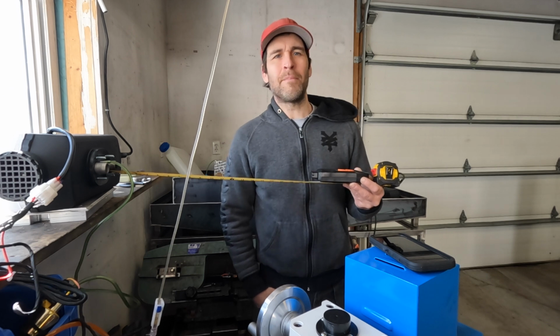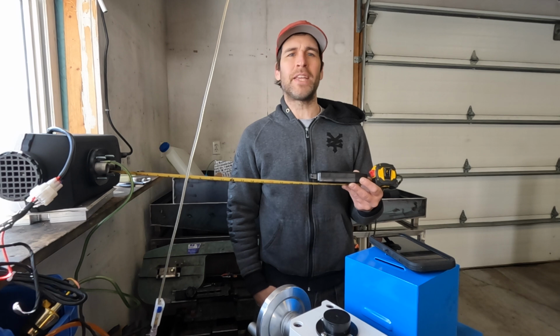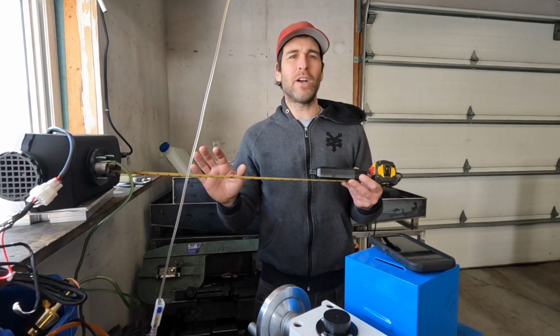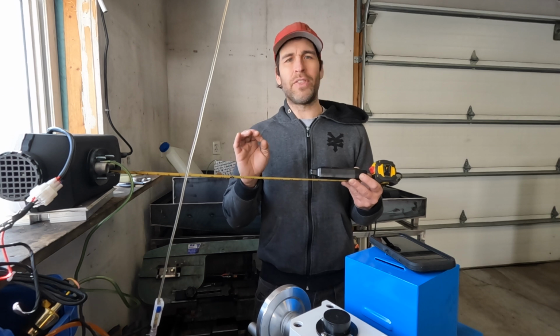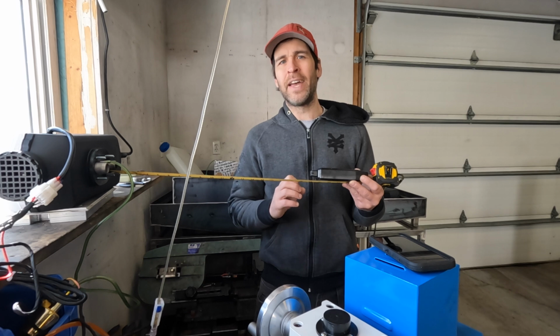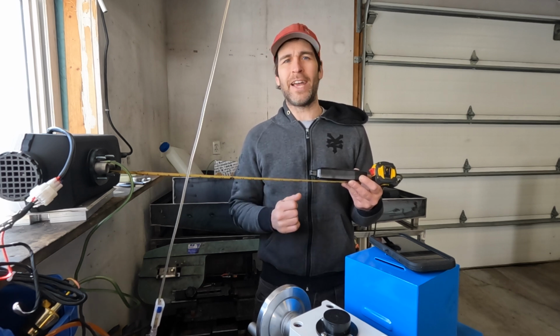The 1 minute timer just went and we are at 57 parts per million. I saw it go as high as 61. I think the reason for the fluctuation is that the pump is changing or varying. So we're going to call this a low of 46, high of 61, and then we are going to run the same test with the modified fan housing.